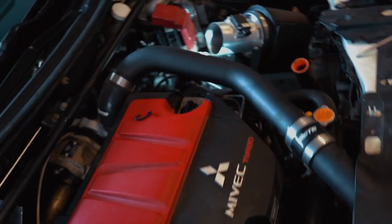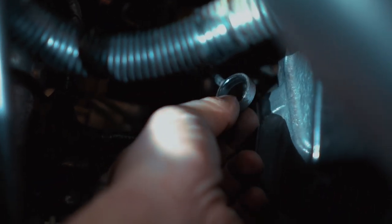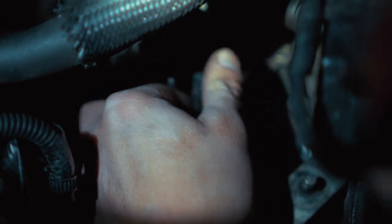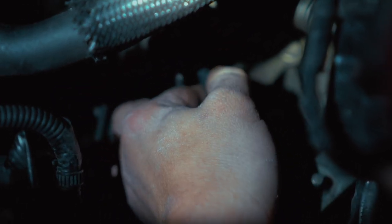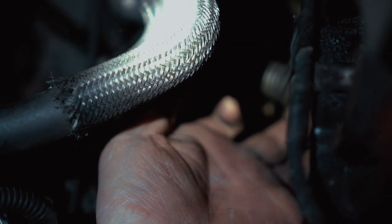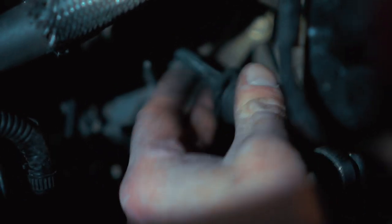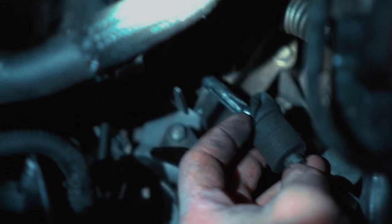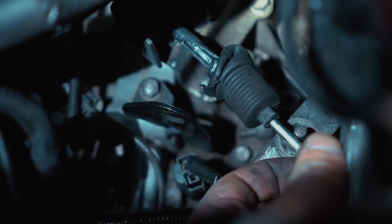It's really hard to show you guys - it's so far down in there. But here's what that cable looks like without any bushing on it. And I think I found another reason for my shifting issues - this front cable is completely destroyed under this boot. I pulled this boot back and that whole top side of the cable is worn out. So this cable should not be floppy like that, it should be pretty stiff. I gotta either jimmy rig that back together or replace that cable, but for now let's throw this bushing in and see what happens.